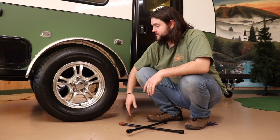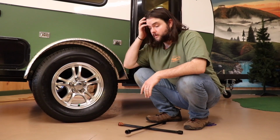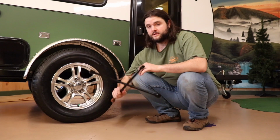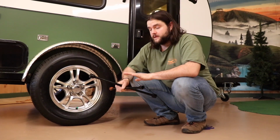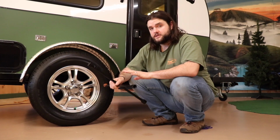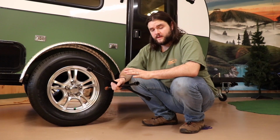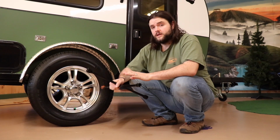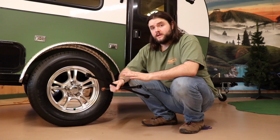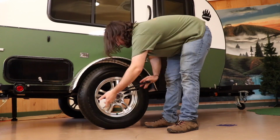Once you bring this down onto the ground, you want to tighten these up in a star pattern, and I'm going to show you that real fast using the 4-way. I'm going to be doing this, tightening them up good and snug. I would advise you to, as soon as possible, tighten these things up with a torque wrench, which we will actually be showing how to do in the next video. So now let's snug these up.